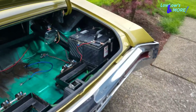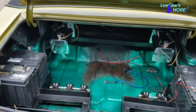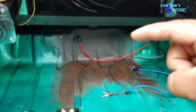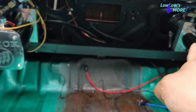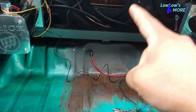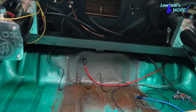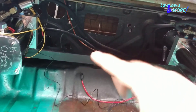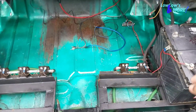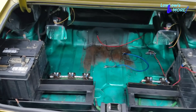It got pretty late last night, so this is where I left off. The pumps are in and hooked up to the cylinders. All I've got to do now is wire the dumps. I need to put the subwoofer in here, so I'm going to do the grounds for both pumps and a ground for the amplifier, screw it down on the bar. Then I'll touch up some paint before I put the subwoofer in, and once the dumps and amplifier wiring are done I can install the sub and amplifier and finish putting in the batteries.